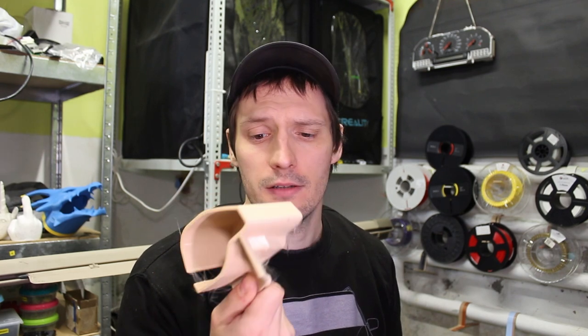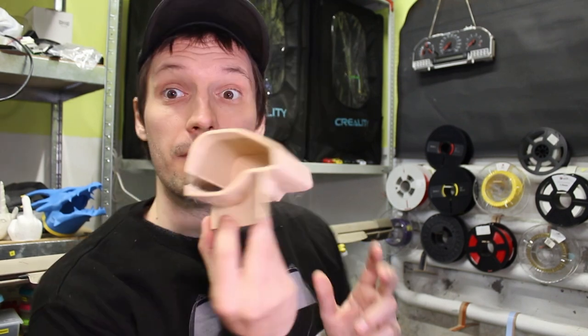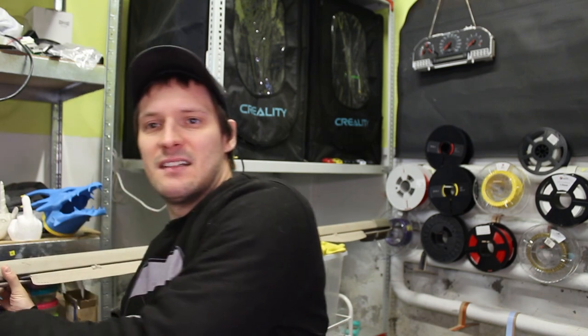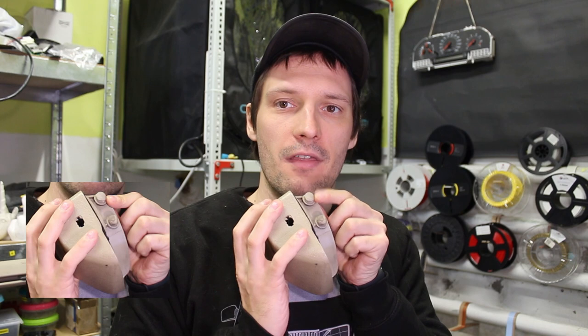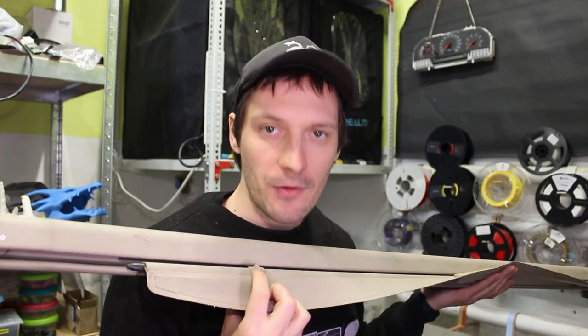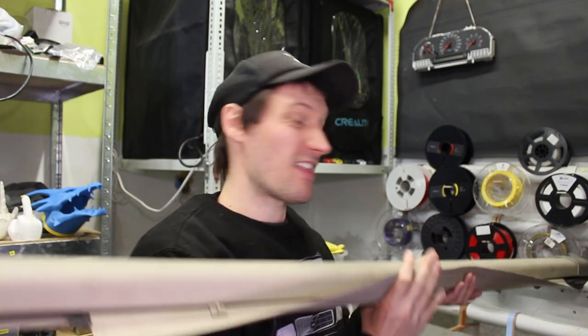If your end cap is broken, I still got you covered. This is a 3D-printed end cap — you can download the model from a link under the video. I've seen some already and they are operating in cars. Print it from ABS or ASA plastic — PETG is not enough, don't even try. PLA — no. Also, you see these rubber pieces? If you have those missing, you can also download them from the link in the video. I designed all of these — everything is in the description. There are links in the description, find them.